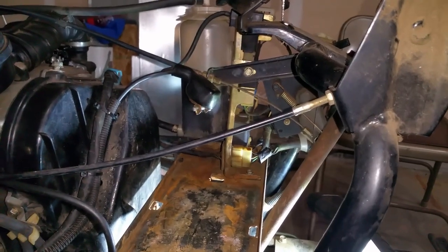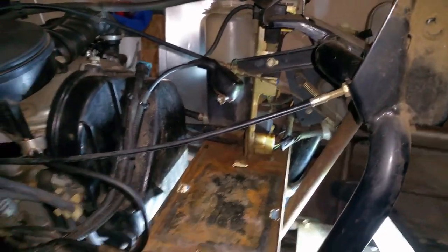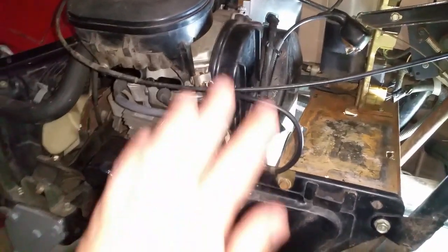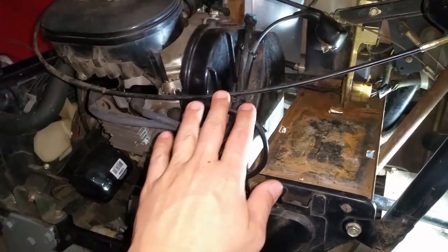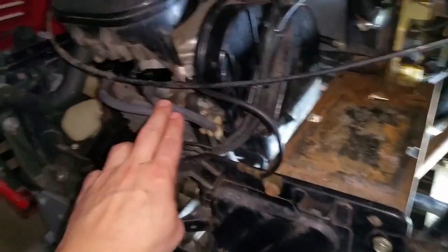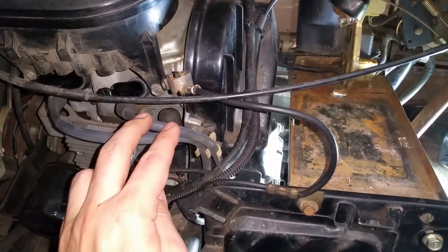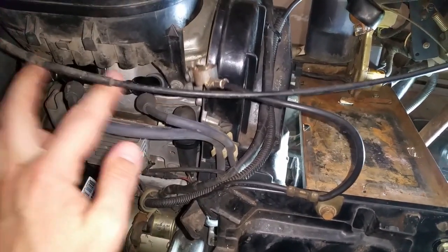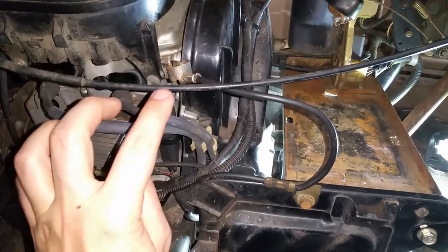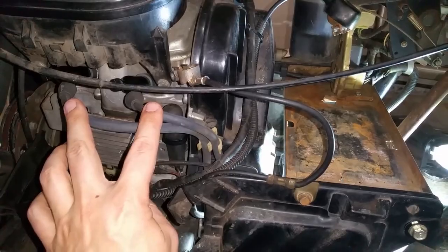It may fight you, but loosening that will be the better course. I've already zip-tied and put away all the wires to where they were before. I got a new ignition coil in, just like I did on the 4514. The long wire goes to the front cylinder and the short wire goes to the back cylinder. I also got some new noise suppressors — it's a good idea to change both the ignition coil and the suppressors. These are separate parts from the ignition.